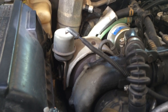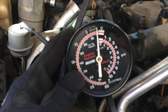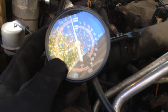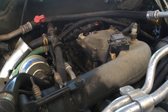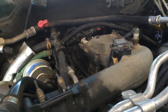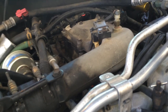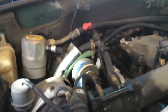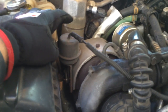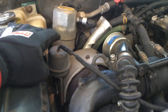We're going to test this with a vacuum gauge — we're measuring inches of vacuum, not pressure. You can pick one up at Sears or Harbor Freight. We're going to disconnect the source vacuum line from the pump going to the wastegate solenoid and make sure we're getting at least 15 inches of mercury of vacuum out of the vacuum pump. That tells us the pump is good and the line from the pump to the solenoid is good. If not, either the pump has a problem or we've got a leak in the orange hard line. If that's okay, we'll then check the vacuum coming from the solenoid over to the actuator to confirm actual flow through the solenoid.